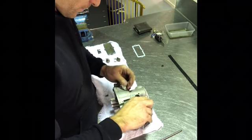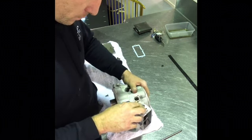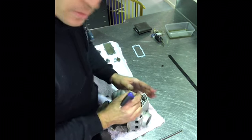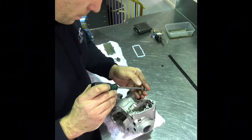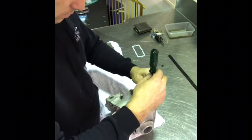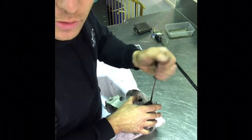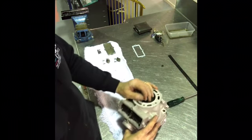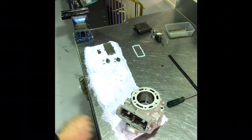You can then put this retaining plate in. On this front side, the retaining plate there, and use the Phillips head screw or bolt to hold that in position. Technically, I actually should have put this retaining plate in before I tightened up those little 3mm head bolts, so I might just double check it. Just need to get myself some pliers.